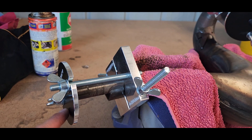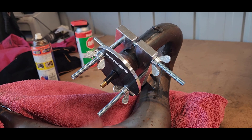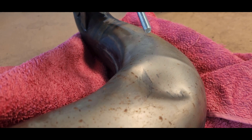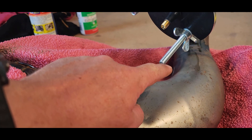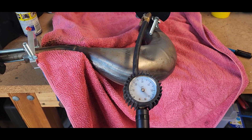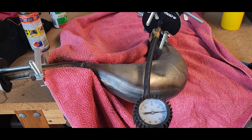I've got the Minnow kit on each end and I've screwed that on. I'm going to put 50 psi in. But here's the dint — the pipe hit the head, you can see there. It's about the size of a 50-cent lid there, so it's not that big. The only thing I've got to be careful of is not to burn the threads and the valve when I heat it up. The manual calls for 40 psi, but I found you need to go to about 55 to get good results. So I've got about 55 there.